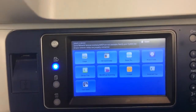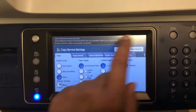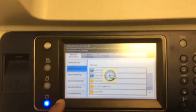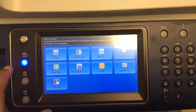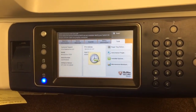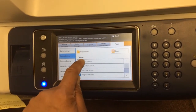Moving swiftly on — you'll see that this feature on a Xerox machine is quite advanced; you can set more than just color defaults, everything can be set at once. From the main home screen you would select the information tab, then select Tools, then Service Settings, then Copy Service, and select Feature Defaults.